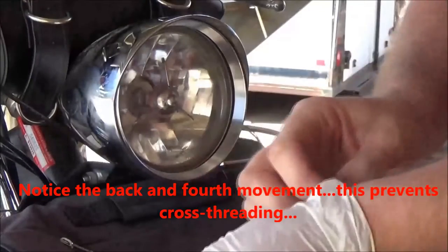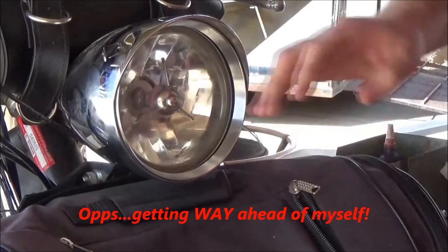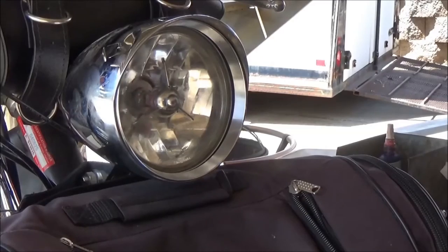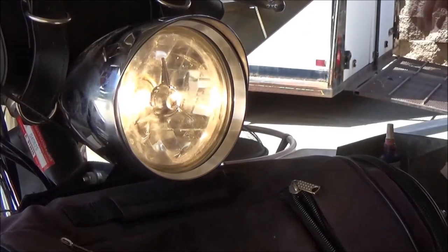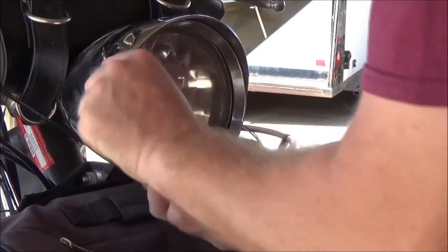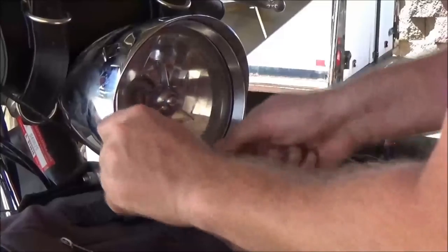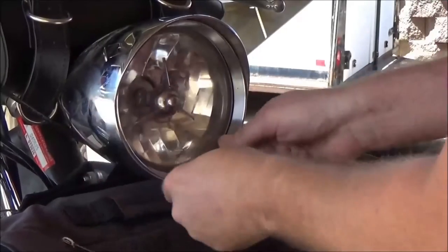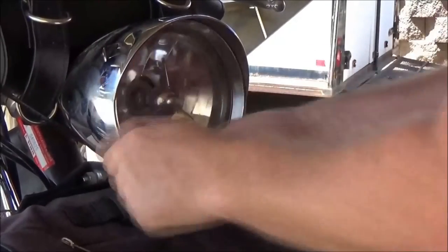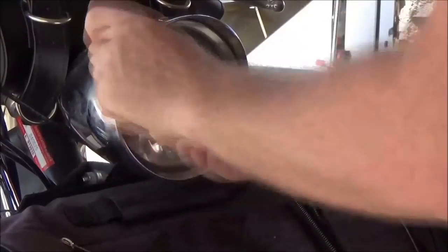At this point I take these gloves off — they're really just so that you don't touch the glass and the bulb. Hey, another tip before doing this any further — I'm actually a little bit ahead of myself here. Before you fully assemble it, make sure that bulb is good. You can have brand new bulbs that are no good. Going high — I can keep going forward. I want to make sure — there was like a snap or a click. Notice how I'm going back and forth, making sure I'm not cross-threading this and that I've got good threads. If you have any junk, bug guts, grime, or anything that's gotten down in there — maybe from touching things — stop, clean it off, check your work.